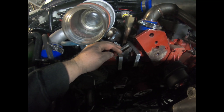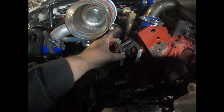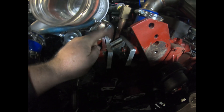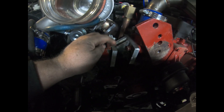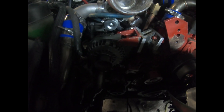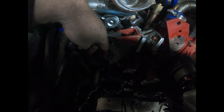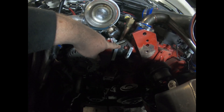These are just tacked because I knew I'd probably have to adjust it, so I can just cut these two tacks — there's two on the bottom as well — and then adjust this plate ahead. I might run into some issues with this bolt that runs through right here; I might have to slot it, notch it, or drill and tap it so the bolts thread into this piece and I don't have to worry about them going through the other side. Let's get this alternator back off, measure how far it needs to go — basically just measure the length of the pulley and bring it ahead that far. Should have plenty of room to do that.